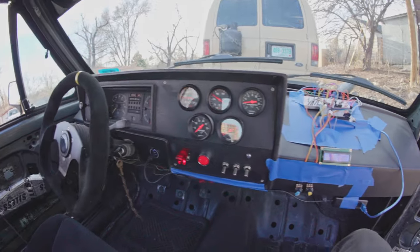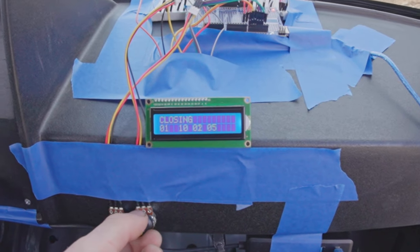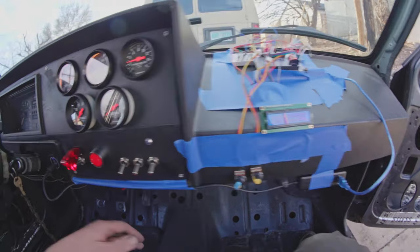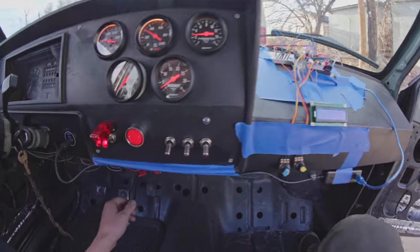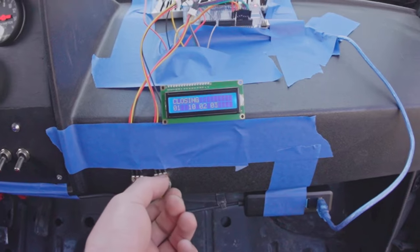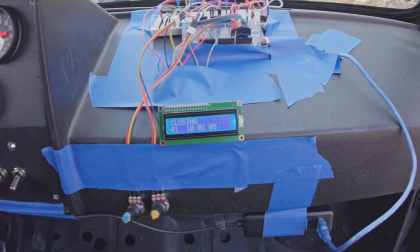Dave had to go, but I managed to get this thing all taped to the dashboard — and it's freaking sweet. This is drive pressure adjustment and this is boost pressure adjustment. Right now my drive pressure limit is at 10 psi, and if I go with the vanes all the way closed, you can see we build quite a bit of pressure. Now if I turn it back down — asking for 3 psi — look what we get. Totally works. It's slick. I'm going to go for another test drive and try 10 pounds of boost and 5 pounds of drive pressure, starting low.